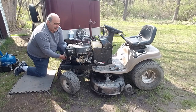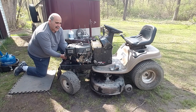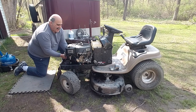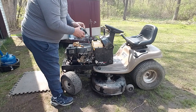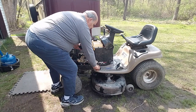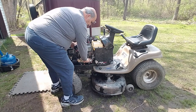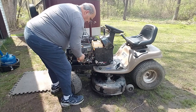Like I tell my son and my grandson — you know you're at least an amateur mechanic when the tips of your fingers can feel the nuts and bolts going in correctly. You sort of have a sixth sense — when you can't see the part, you can actually get it seated and connected without looking at it. Next is the oil filter. I got a new Kohler oil filter that I was going to put in before this project. I like to put a little bit of oil on the gasket and make sure the mating surface is clean with no particles down in the sump.